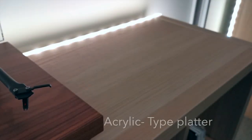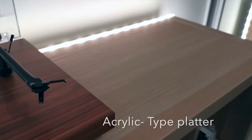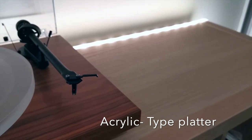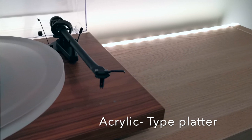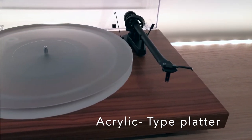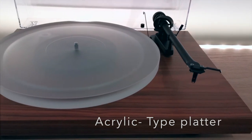The first topic is the weight of the platters. Depending on the weight of the platter you use, it can have adverse effects on playback sound. A heavier platter will result in more well-maintained playback speed. This is due to rotational mass — the inertia of the rotating platter results in the platter taking longer to react to speed changes.